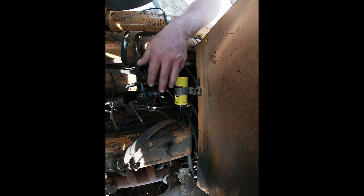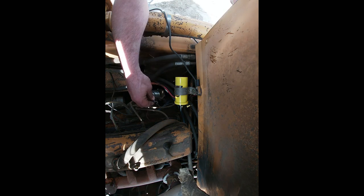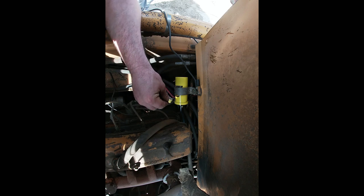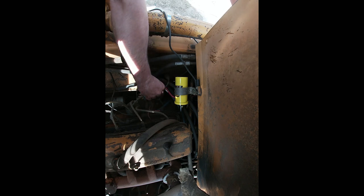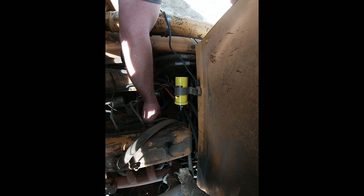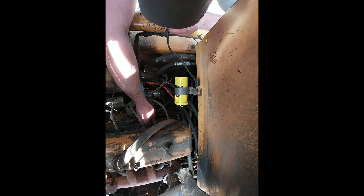I don't have the screw, so I'm going to have to get a little creative with zip ties, I think. We've got to make sure which wire has positive. This one should be the hot, because this wire comes from the distributor, so that should be my negative signal, as would be typical. And then this, I'm assuming, is going to be temp sensor there — actually, that doesn't look like it's going to be temp sensor. That looks like maybe something for the coil, and this maybe is temp sensor. That's the problem with having stuff that's been taken apart before you got to it — you really just don't know what is what. But we're going to figure it out nonetheless.